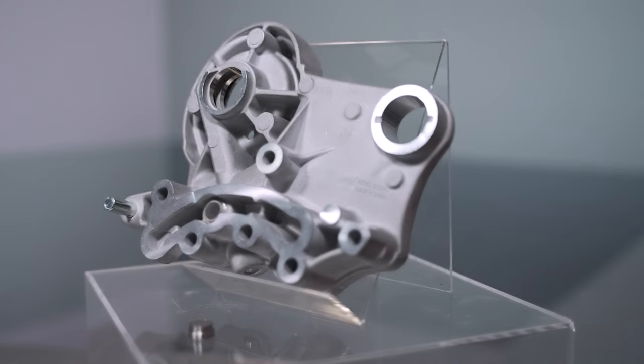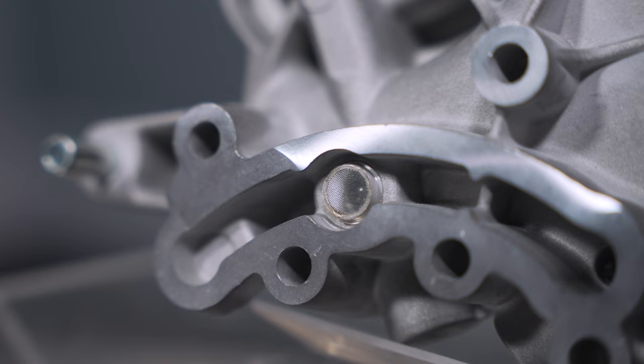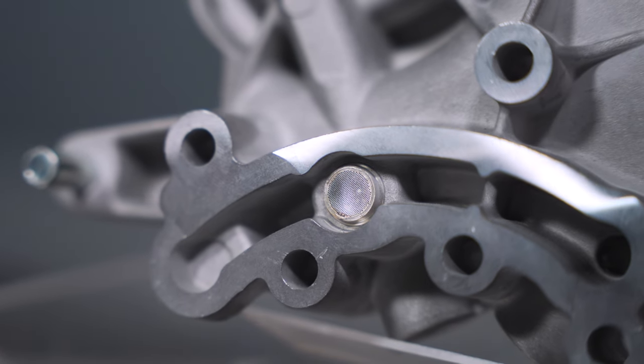After a few revisions of the part, Audi and Volkswagen gave up and told owners and technicians to simply remove the screen within the camshaft bridge. We thought we could do a little better, so we came up with a bridge using a screen of our own design.